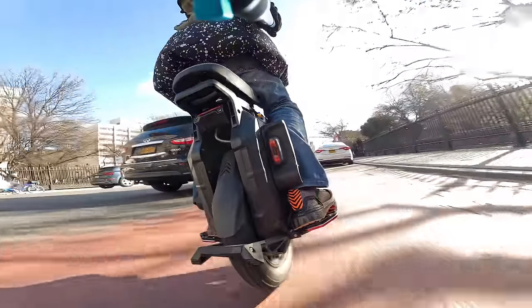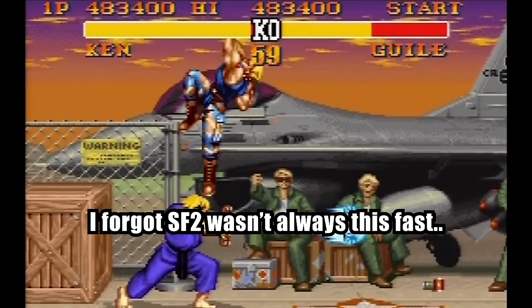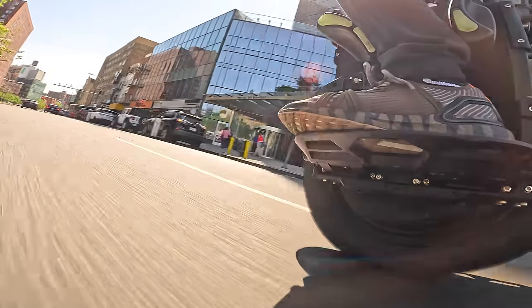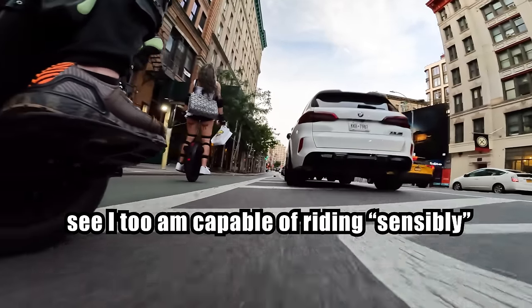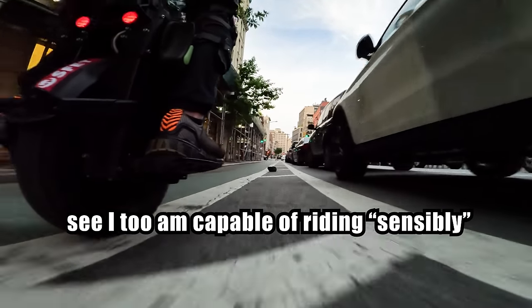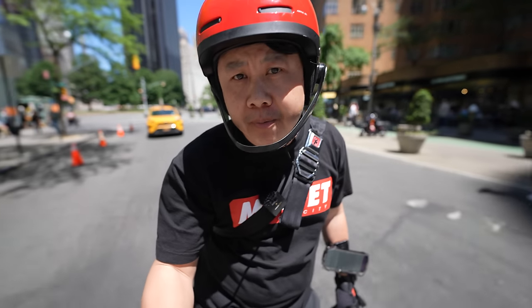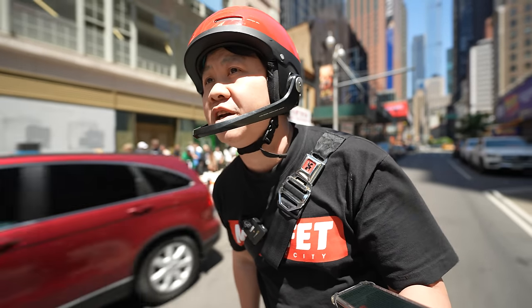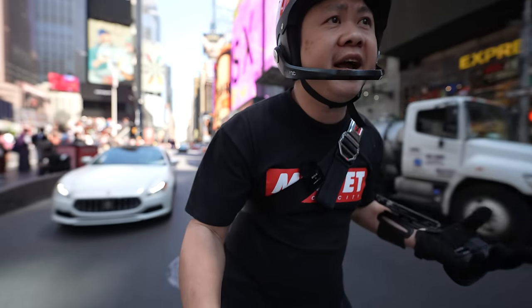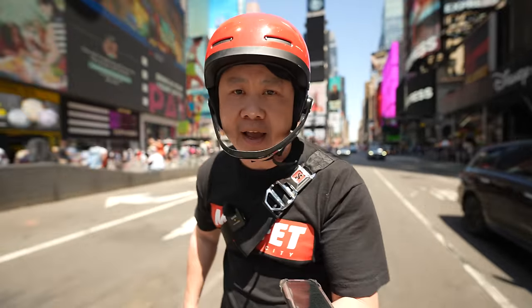Comparing an 18-inch electric unicycle to a 16-inch one is like comparing Street Fighter to Street Fighter Turbo. And with the added speed and torque from higher voltage, the difference in demand for faster reaction time is even greater. Not everyone has to speed run a Super Mario level — you can slow down and take your time. But relatively speaking at the same speed, even at 5 miles an hour, a larger diameter wheel will be slower to react, and from the perspective of someone acclimated to a smaller wheel, it's going to feel laggy. This is why a smaller diameter wheel is generally easier to learn on — its faster reaction time provides feedback quicker.